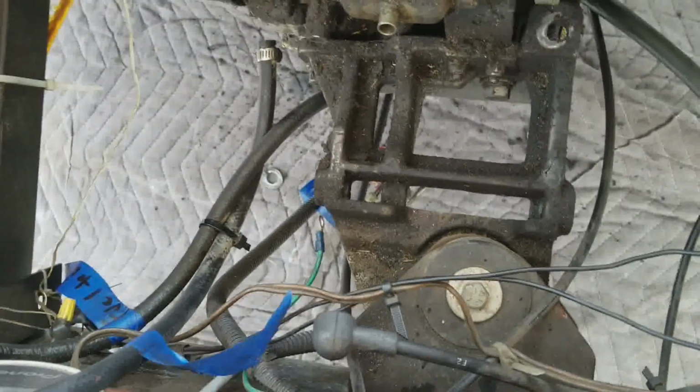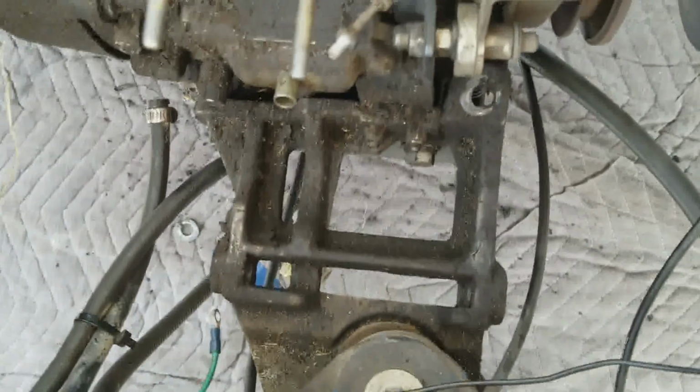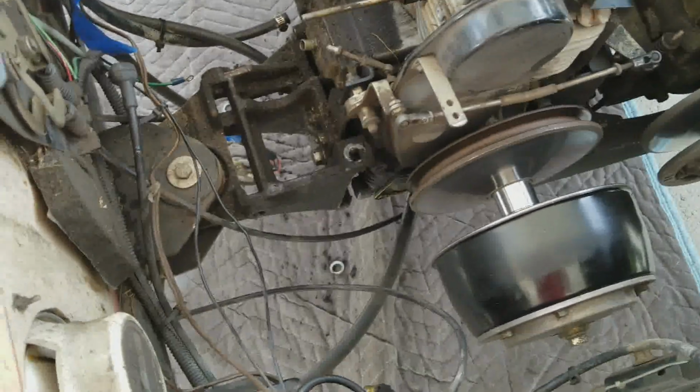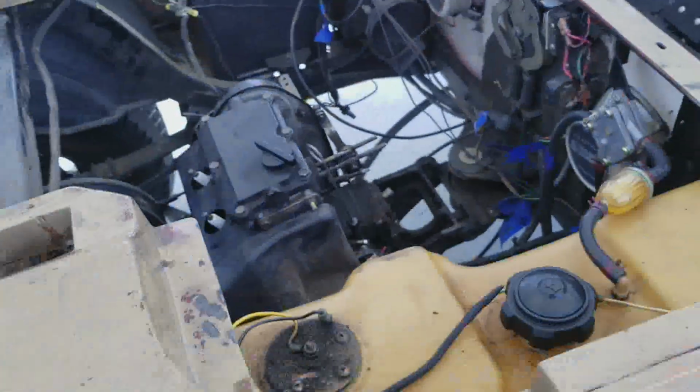So that starter generator cradle is where the front mounts go through, and the rear mounts, as I said earlier, are back here. Those should be the only four things holding the motor in place right now, right? Yep. All right, so once we take those engine mounts out, we're going to have to lift the engine out. So we'll see how this goes, see how strong I am.